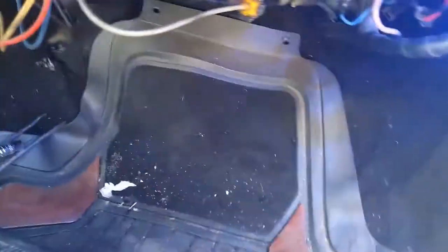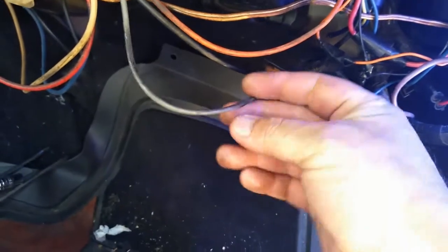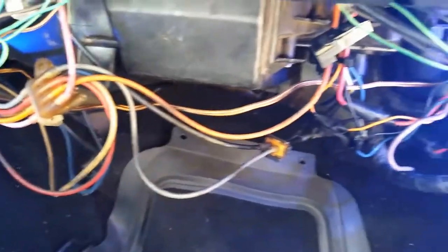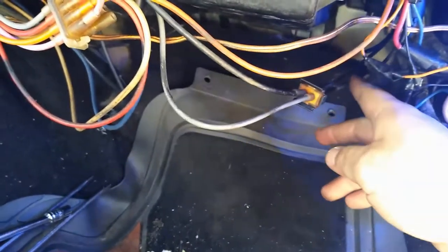This is the main hose that goes from the engine — this one right here is for the AC. It's the vacuum hose that draws air from the engine and opens up all the little actuators for your AC to cool things down. My issue was that it was cracked somewhere down near the wiring.